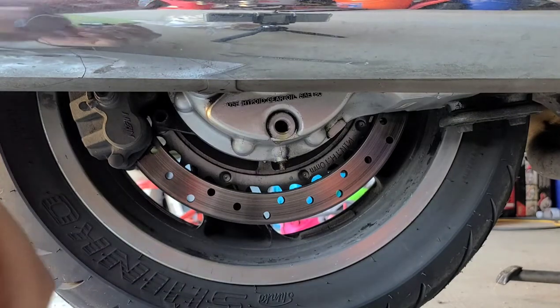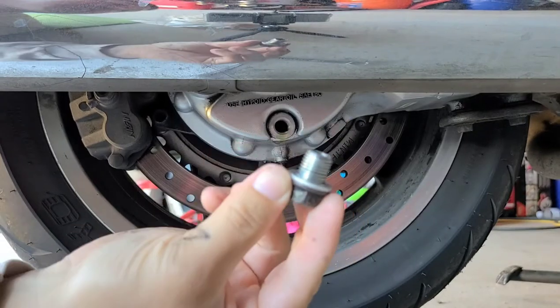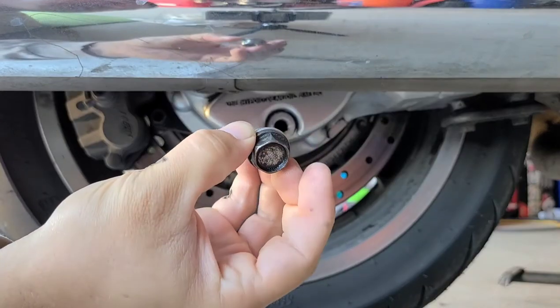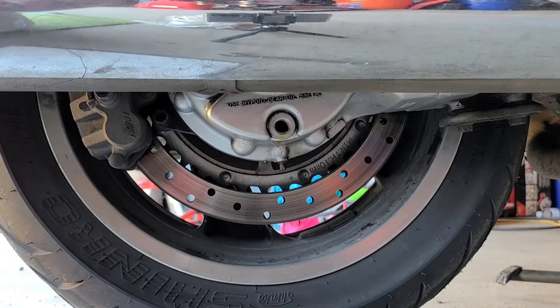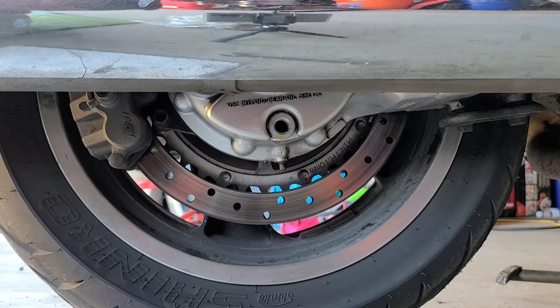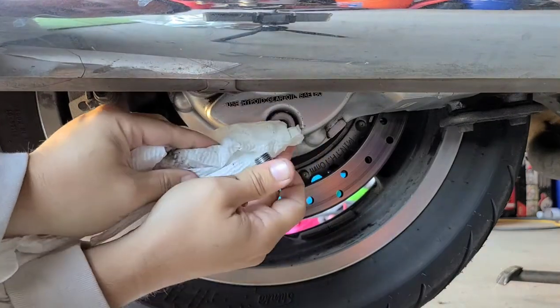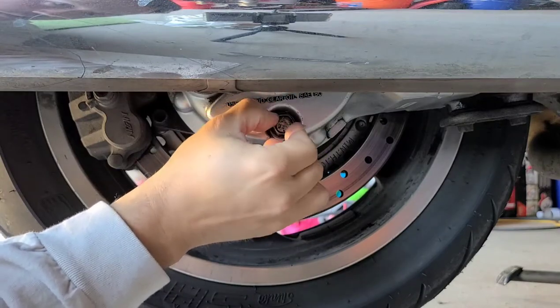I'm back — we're pretty much done dripping. You can see how still how clear it is. I cleaned up our bolt — this was the drain plug bolt. I'm wiping that up now that I got it out of the oil. I've been letting it drip into a small plastic piece. Let's get a clean spot on our paper towel, wipe this off one last time, and set our drain plug bolt back in there.